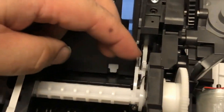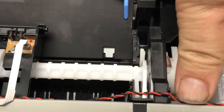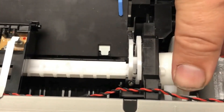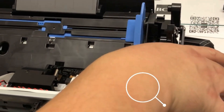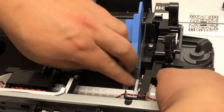Here's the broken part. Here's a working printer — I'm turning the holder clutch. You can see the shaft LD is turning and is pushing the paper tray in the back, it's called a hopper — it's pushing the hopper plate in the back. For comparison, here's the broken printer. When we turn the wheel on the holder clutch, you can see this part is broken. When I turn it, it cannot push the hopper towards the back. You get a spring in the back of the hopper, and that's actually the reason you break this. You have to make sure that your hopper can be pushed back.